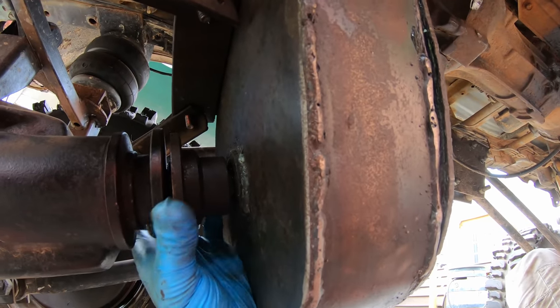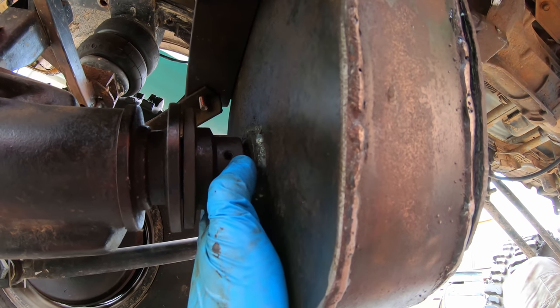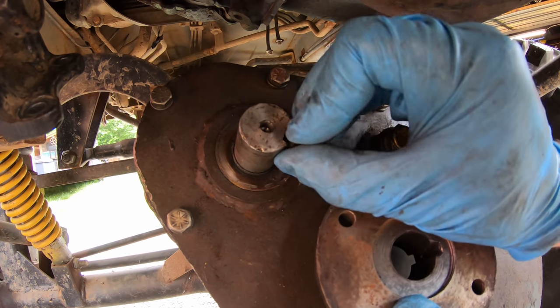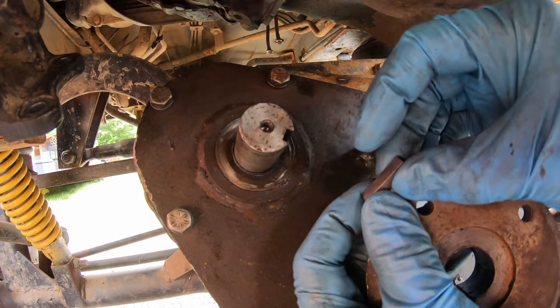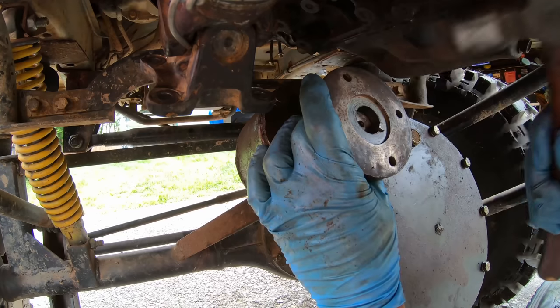However, this, you know, it's keyed, but it's got these Allens you can loosen and then bring this out. The other side had the drill bit in here for a key, which works, but the problem is this is not a soft metal, so if this has to slip, it can't shear. Like keys, they're made out of a softer metal that can shear off if need be.